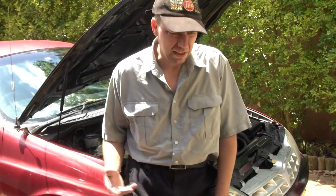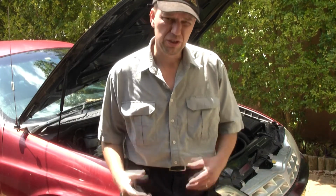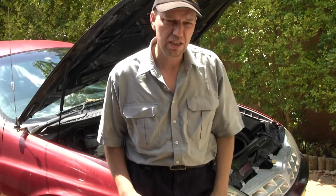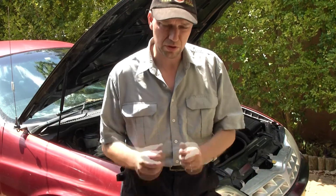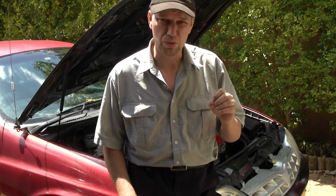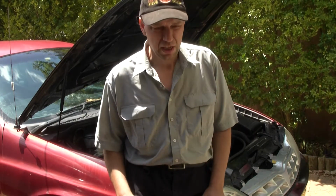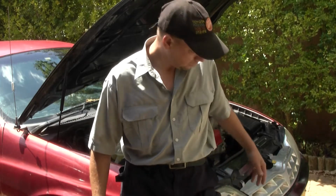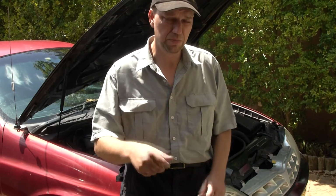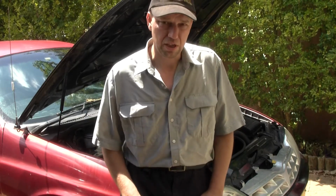Now, before I get started again today to do this next part, I've got to be fair dinkum about this. The method of putting a sock on the radiator, Peter does mention a summer sock, so it's nice and thin. I don't have any. I tried to use a winter one because it looked like it had enough space. When you push it through the radiator hole, which is probably about 1.25 inches in diameter, maybe even 1.5 inches, I didn't measure it, there's not enough flow. What I'm getting from the reservoir is a single hose, probably about 1/4 inch, that separates from the radiator, goes past the radiator, and I think that's where most of my circulation is coming from.